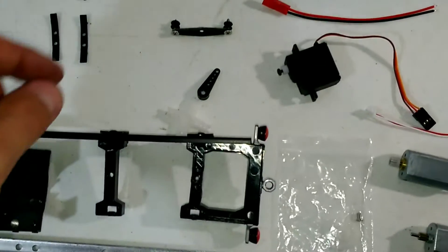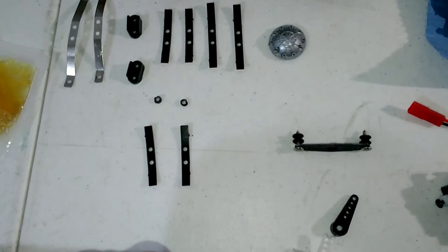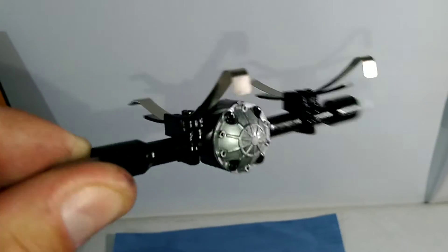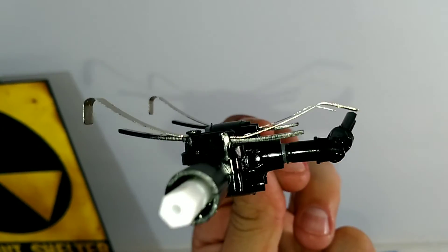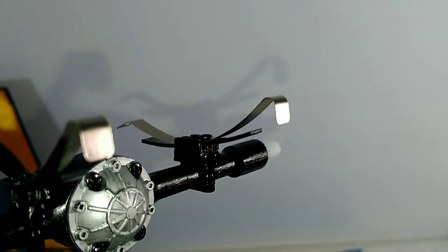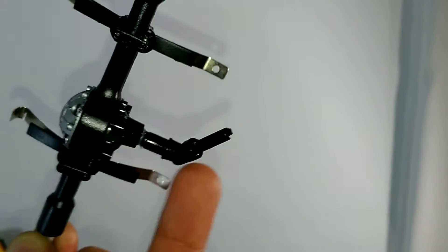I also wanted to show you — I made some little spacers out of the four-way servo horn to clock the axle. I painted them black. There's the stock one and you can see the leaf spring raise up — there's a spacer in there. What that's going to do is clock this back to get rid of the extreme drive shaft angle that these have. They also put more wear on the drive shaft than needed.